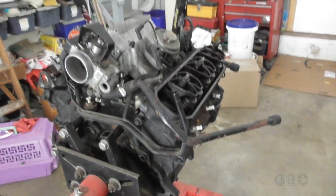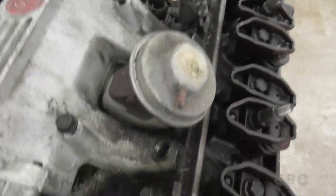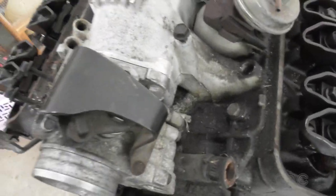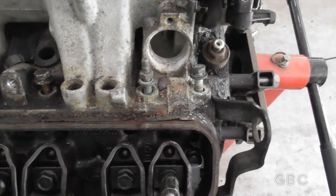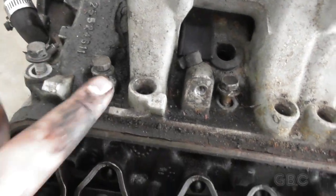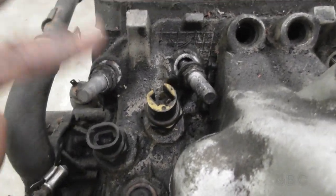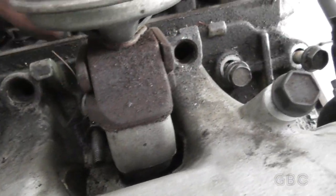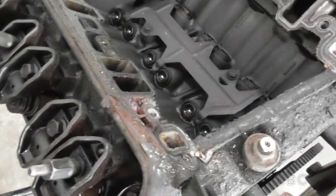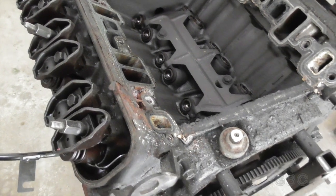The next thing I'm going to do is remove the intake manifold. With the coolant tubing out of the way, I've got a bracket to remove and then the rest of the manifold bolts — once those are off, the intake should lift right off. A quick note: on the side of the engine that's supposed to be at the front of the car, we've got bolt, stud, bolt, bolt, bolt, bolt. From the timing chain cover side: stud, stud, stud, bolt, bolt, bolt. We've got the intake manifold off and the intake gasket removed.